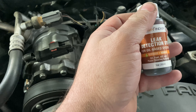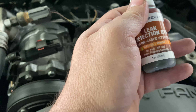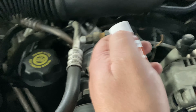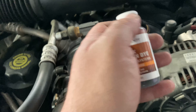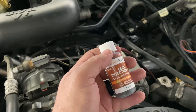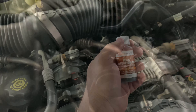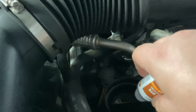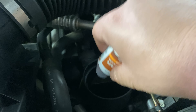This is for oil-based lubricants — it says oil, ATF, power steering systems. I'm going to throw this in with the engine oil because I already confirmed I'm not leaking anymore from the power steering pump, but we're going to throw this in, run it for about five to ten minutes, and check it out with the black light or fluorescent light to show you how this works. Go ahead and add this in, and once it's all in you run it for about five to ten minutes.